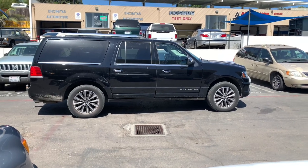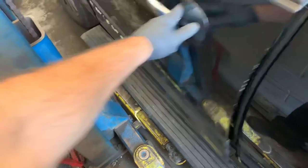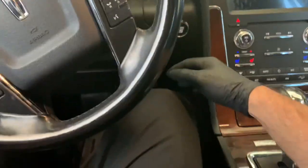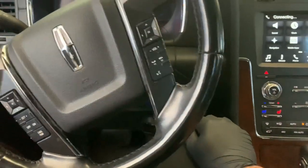If you're working on a Ford Expedition or a Lincoln Navigator and you need to put it up on your hoist, you need to shut off the power running boards. To do that, it's pretty simple. You're just going to jump inside the vehicle. We need to turn the ignition switch on, push it twice with your foot off the brake pedal — that powers everything up.